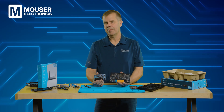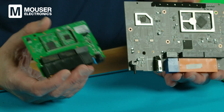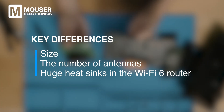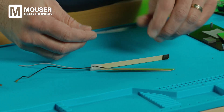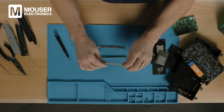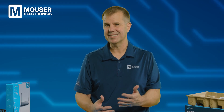As we compare the Wi-Fi 5 and Wi-Fi 6 routers, we did see a lot of similar things. This teardown comparison is really interesting because there's a good chance you're watching this using a Wi-Fi connection through a router similar to one of these. Despite the same basic objectives — wireless communication at 2.4 and 5 gigahertz — the capabilities are quite different. The most obvious differences are the size, the number of antennas, and the really heavy heat sinks inside the Wi-Fi 6 router. Most striking was finding three different antenna designs inside those six antenna housings, fabricated on three different substrates, with two different antenna feed points and two types of RF connections to the PCB. RF design is complex and maybe still a little like magic.